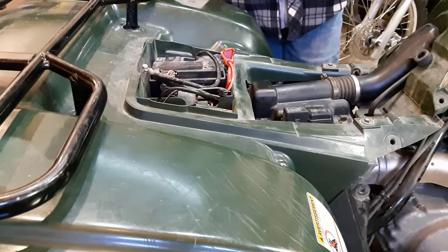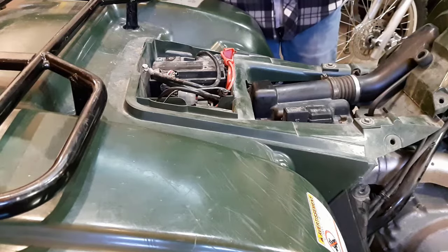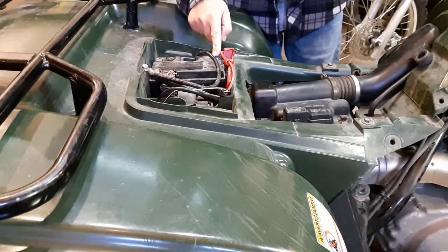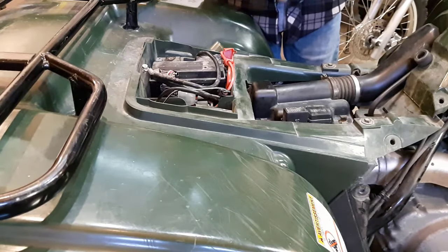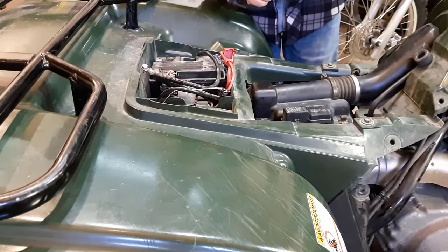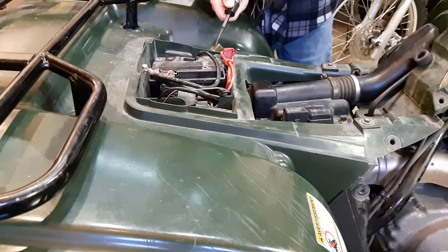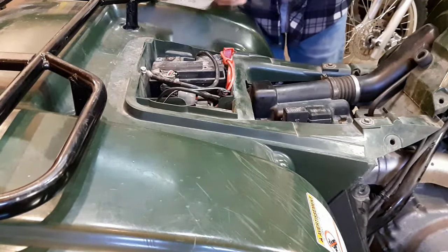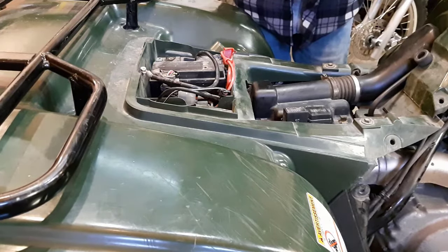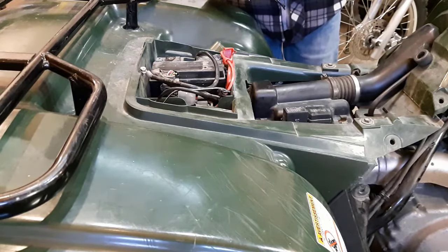So I know that my starter was the culprit here. But what you want to do to make sure that your starter is or isn't the culprit — to find out where the problem is — is first you want to check the connections on your battery, make sure they're tight and not corroded. You want to check the connections on your starter for the same thing. Then you want to take a test light like this and test to make sure that you're getting juice to everywhere — to your battery, to your solenoid. You might have to turn the key on and check the connection.